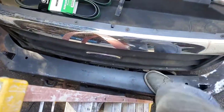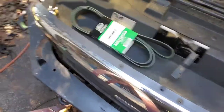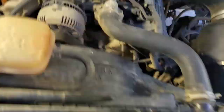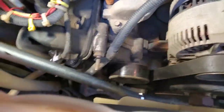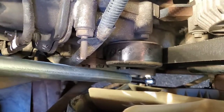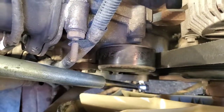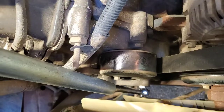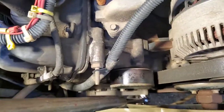I'm using a six-foot ladder. I'm very glad my light bar isn't here so I can step on the bumper. I've got to climb clear up into the engine compartment to be able to reach. Looking down there, I have put my half-inch drive ratchet into the belt tensioner, with my pipe over the handle of the ratchet. If I turn it clockwise, you can see that it takes the tension off the belt.